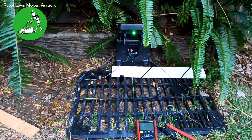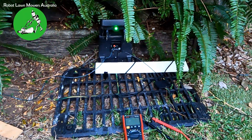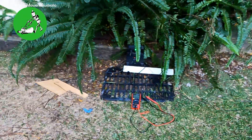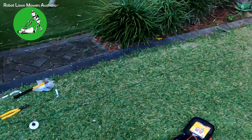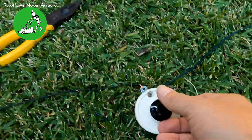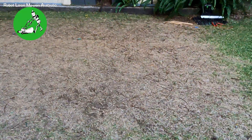What I want to focus on mostly is when you have a solid green light on the base station but you still get the E1 error. The reason for this is resistance in the boundary wire. I've set up a temporary wire and a large variable resistor here, currently set at around 1000 ohms. We're going to test that and show you exactly how.